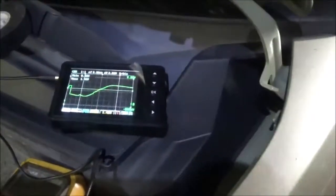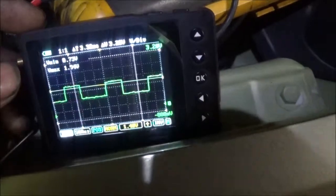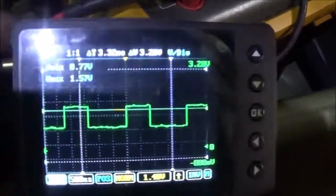So now I'm deciding to use this old trusty oscilloscope. Right now I am hooked onto a gray wire, which is going to be the input speed sensor, so that I can set this scope up right where I can read something. On the scope, the input speed sensor signal is reading — got a good signal.